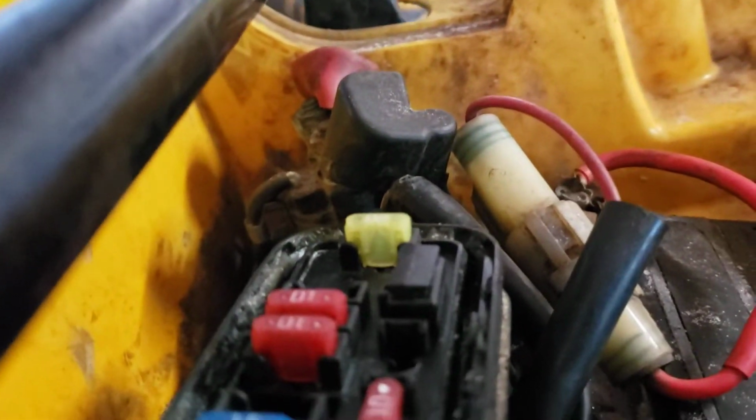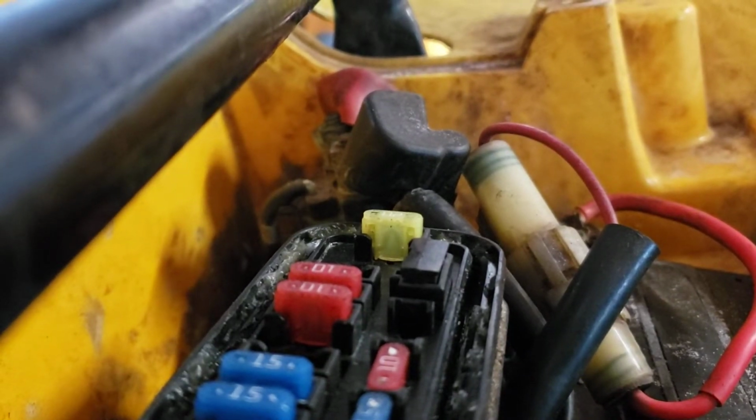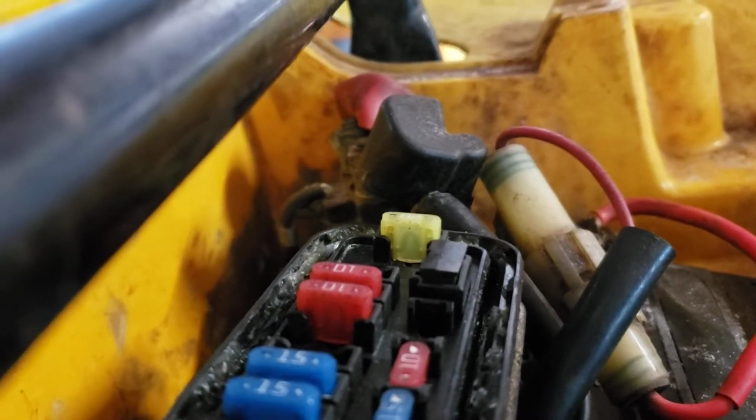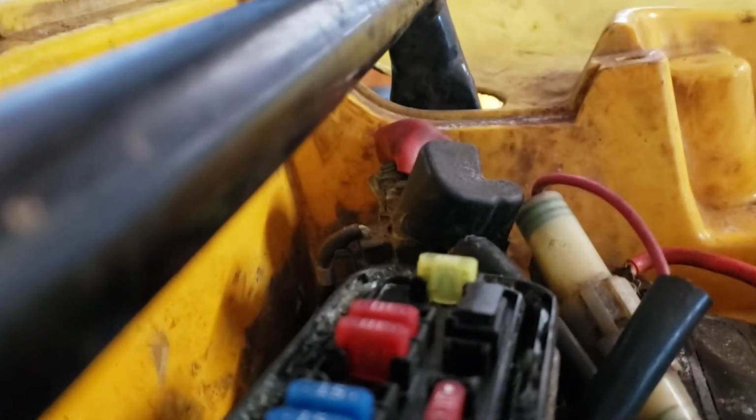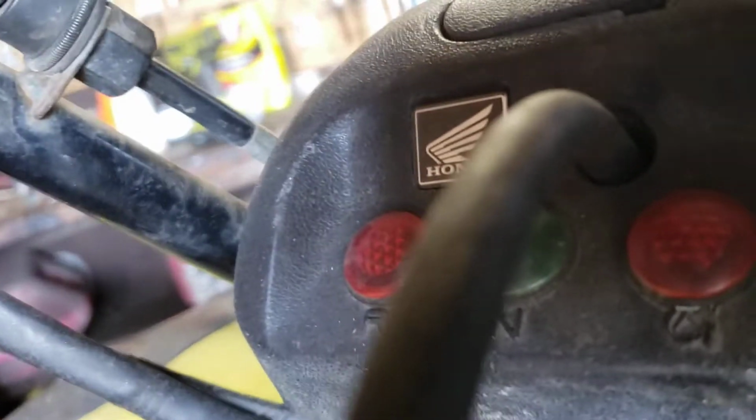I took that one back off, and I plugged in the rest of these, and I put a new fuse in there. Plugged in the rest of them, put the new fuse in there, boom. Fuse still is fine. Now I'm gonna plug this in, and you watch that fuse right there. Boom. Key on. Lights aren't coming on at all. Key on. And it popped.